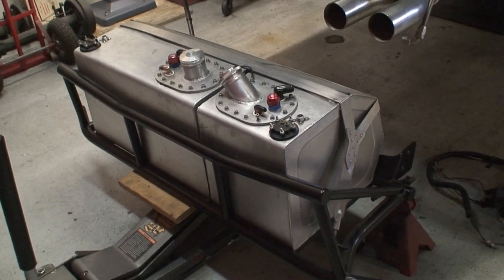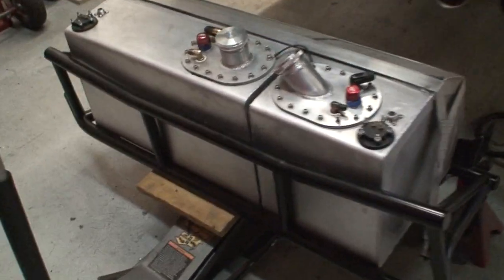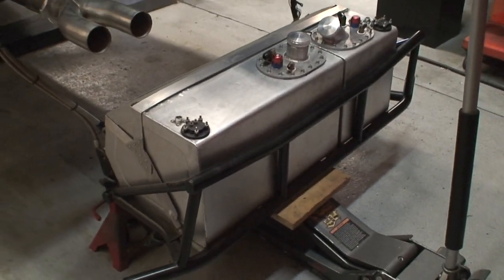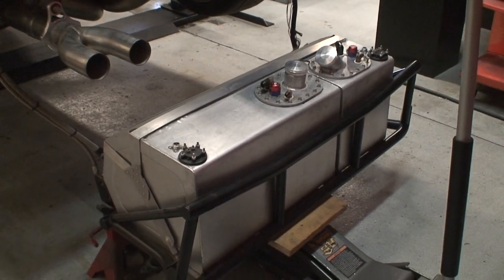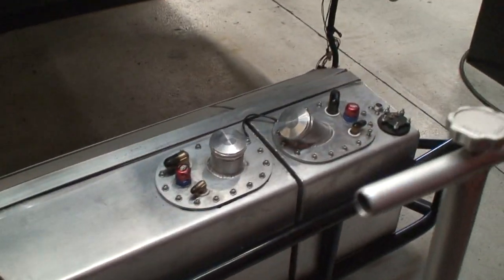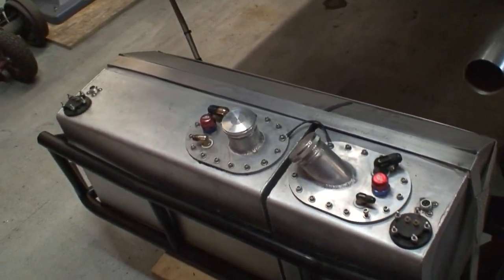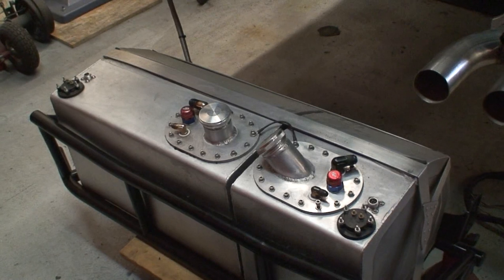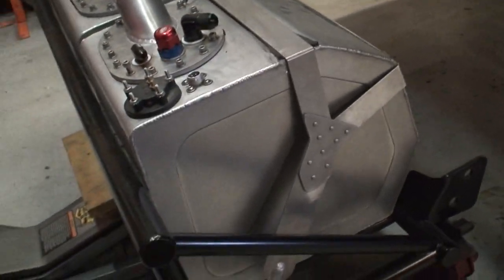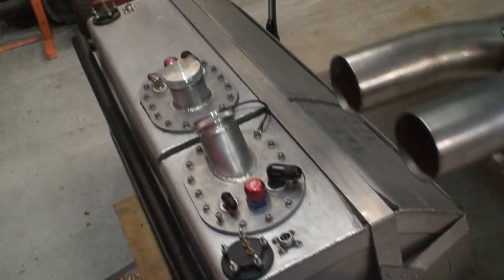There's another neat feature that we've fabricated on the car. The factory Corvettes have a rear bumper assembly, so we've TIG'd up this rear bumper assembly and now it's holding two fuel tanks. We've got one large fuel tank which is 91 octane, and then the second fuel tank is 116 octane — and that's what we call octane on demand. They both have rollovers. Feeds and returns are all built in, the pumps are submersed in the tank, fuel senders. It's all hand fabricated here at Nelson Racing.